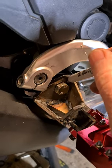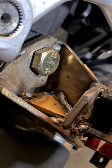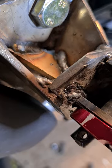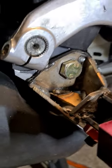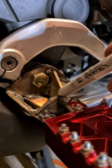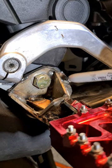I replicated the original aluminium piece by creating an upright between the backing plate and the plate for the ears. This upright follows the doctrine BD cubed — breadth times depth cubed. That's probably the biggest piece apart from the back plate, and it stopped the flex. The top of it is in tension, so when my weight comes down on the peg I'm pulling around the top of the bolt through the welds up the sides.